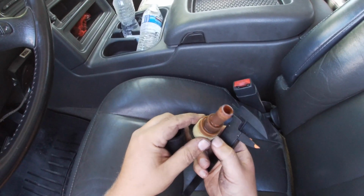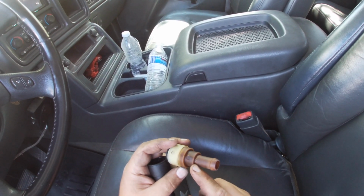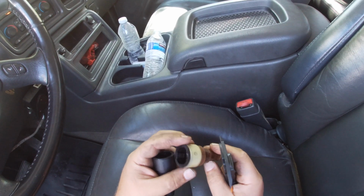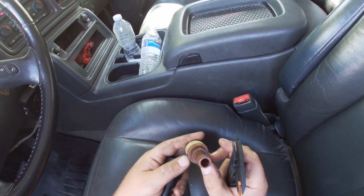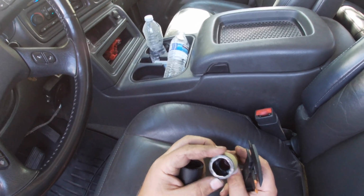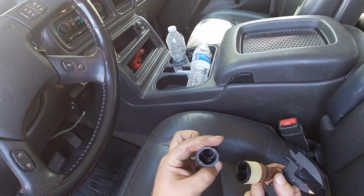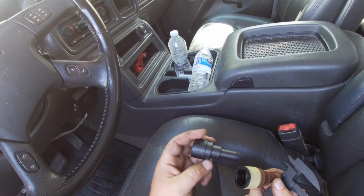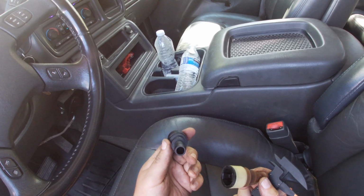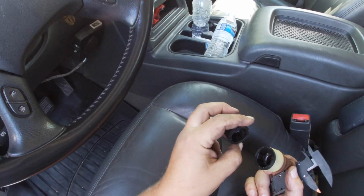And having inspected this, it's pretty obvious to me that this hadn't failed and broken. That spring was probably just losing tension every once in a while, or from vibration would let a little bit of coolant drip out, enough that it was dripping down the side of my engine and ending up on the ground. If the other one leaks, I still have this piece, but in order to make that one work, because the hose on that end has some crimp fittings on it, I'll end up having to cut it and put in a coupler and another piece of hose. But I'll keep this around for when and if that happens.